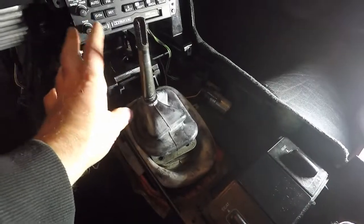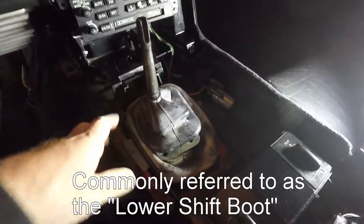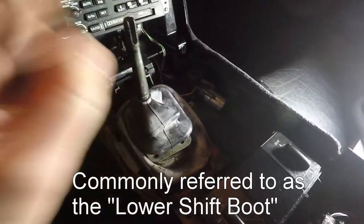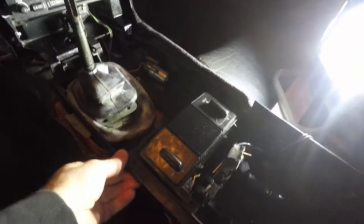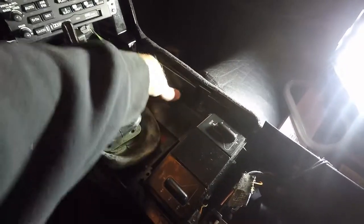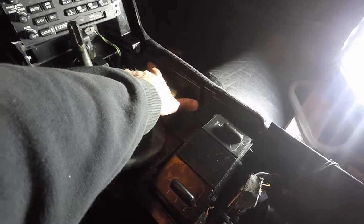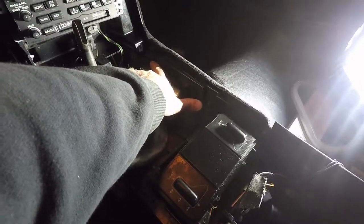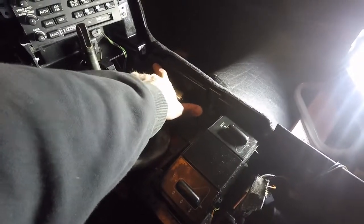Here's the removal for the lower heavy rubber shift boot, accessible from inside the car. I found it important to loosen the console frame — there are two screws there. I didn't take them out because I didn't want to have issues with the lining, the clip pin, or have the clip or speed nut drop, so I left them in but broke them loose.